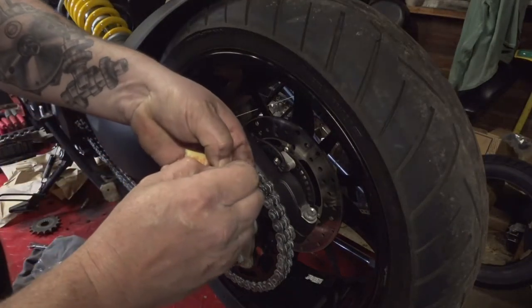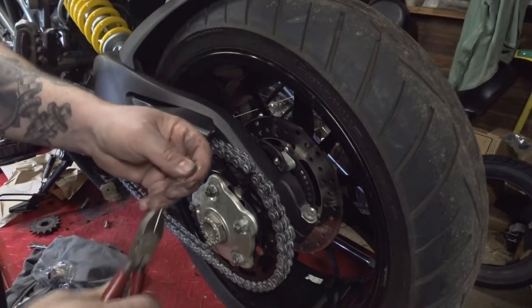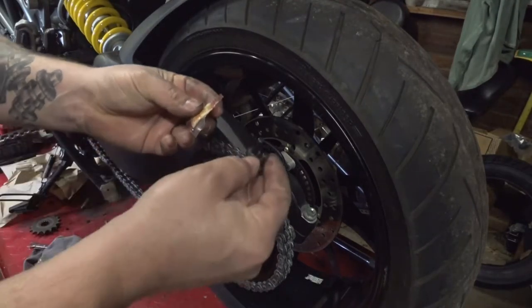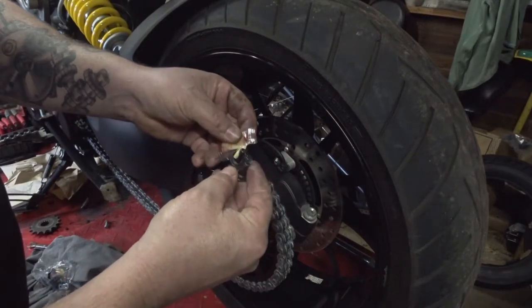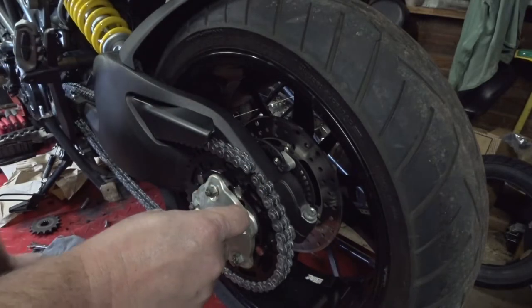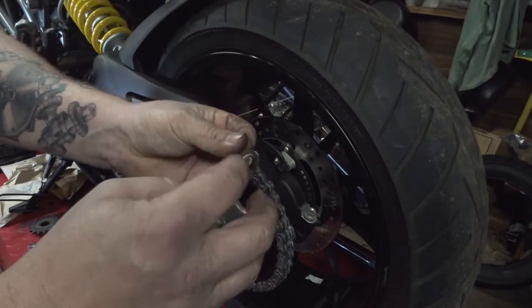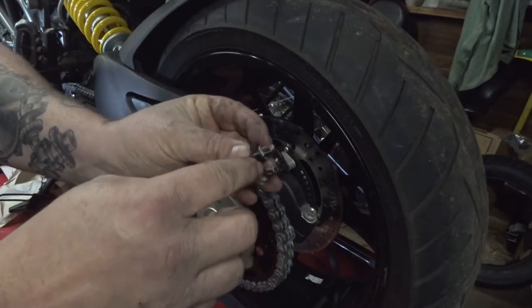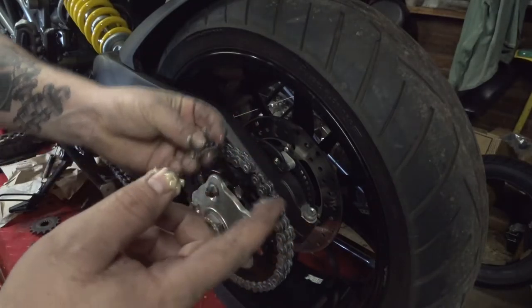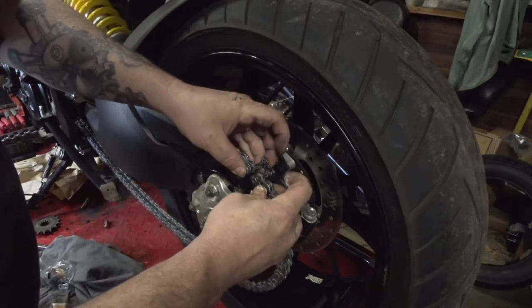So they give you a little packet here of grease. The point behind this is we're going to take the grease and put it on the shafts of the master link here. Make a big old mess as we're doing it. The idea is this lubricates everything. We got the two new seals here already on there, so seals are nice and lubricated up. Shafts nice and lubricated. We can slide in from behind